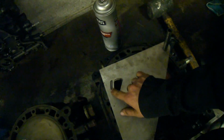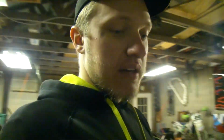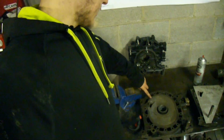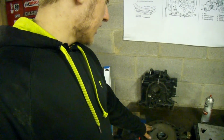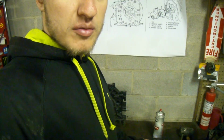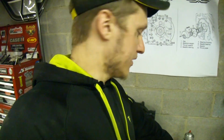So on these, this is a new ball game to me. I have some old 12A stuff, some junk irons over there, and I have this Turbo 2 iron. My goal is to port one of these 12A irons with this Bridgeport template and be mindful of the coolant jacket, like how this one's smoothed in. I'll use this one that somebody else already did as a reference. Then before I do Nick's motor, I'm going to try it on his rear iron here, the broken one, and practice this Bridgeport, because I just really don't want to mess up the new one.